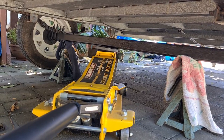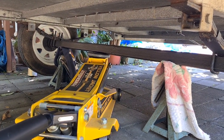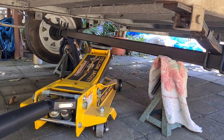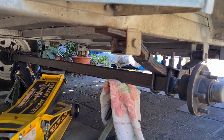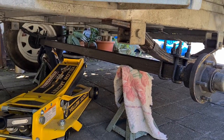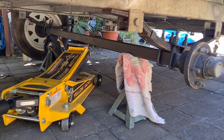This is the trailer and how you jack that up. It can be jacked up on the beam — it's just got two jack stands over there. So if anyone is curious, this is how you jack up a trailer: go underneath at the beam itself and jack it up from there. The reason the jack stands have cloth padding is so it doesn't damage or scratch the axle.